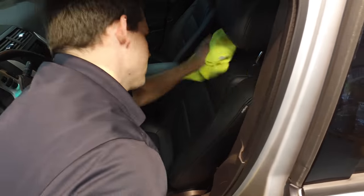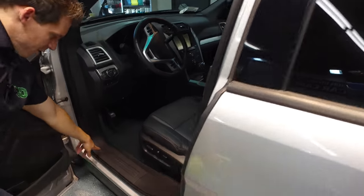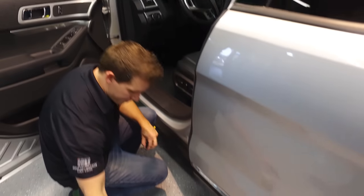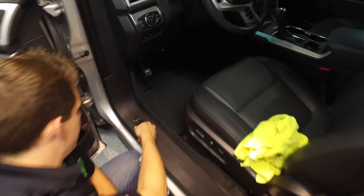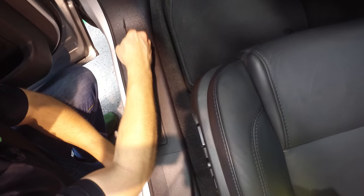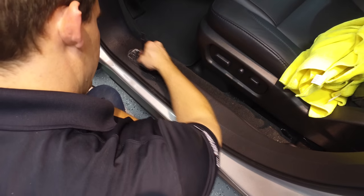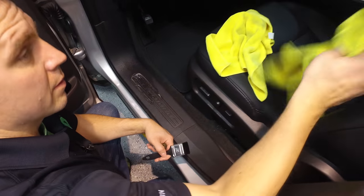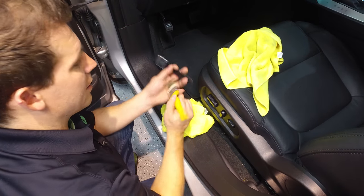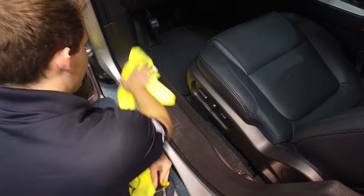Go ahead and get the plastics. Now if you need to get into tighter areas, like this Explorer badge here, a simple fix is to take one of our stiffer paintbrush-style brushes, spray the diluted LVP directly into the affected area, let it sit for a quick second to allow the product to work, then lightly scrub it out. Take your damp dirty rag and wipe out the excess, then take a clean brush to clean out any leftover sediment.